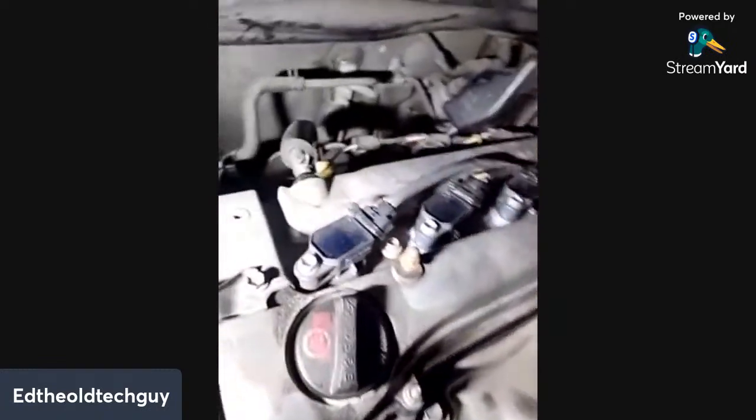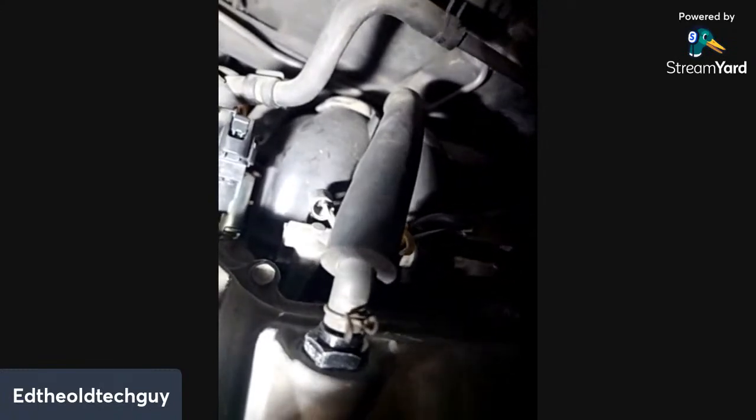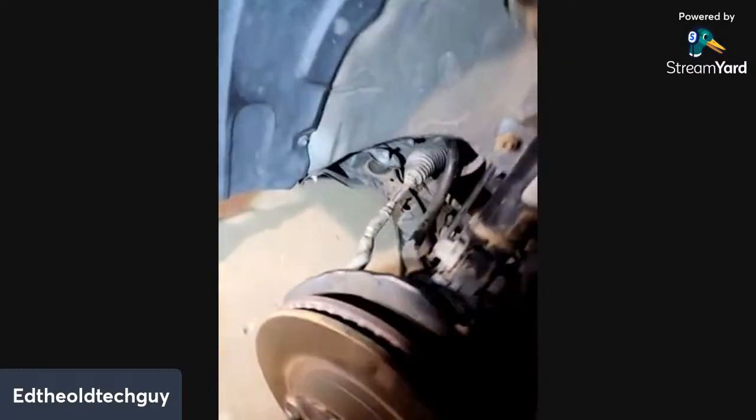I went ahead and replaced the PCV valve right there. And I replaced the VVT, the variable timing solenoid. But there's a screen on the bottom that keeps it clean and unclogged, so I could try to clean up some of that rough idle that it has. Now, the car has 157,000 miles on it, so I think I'm justified in doing some of this work. I don't have to. I could stop right here and say I've done enough. The car is running really smooth right now, but I have it here, so I might as well do it.